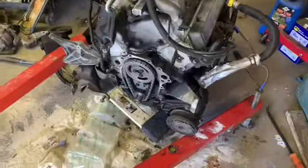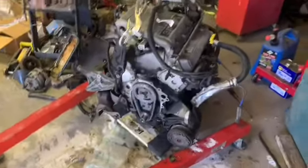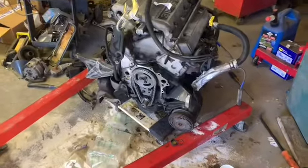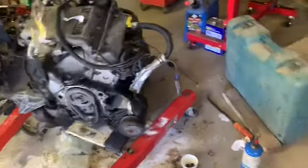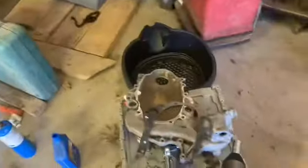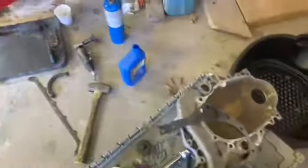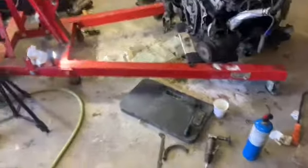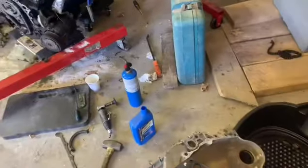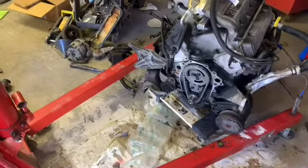Well, as you see, I didn't get it on there. It gave me problems. I'll probably have to jack it up with the crane. Drop the pan some to make that bottom seat in there. Had to wipe off all the RTV, clean off the gasket. Hopefully I can reuse it. I had to get some more RTV, but that ain't happening today. Sometime later in the week, probably.